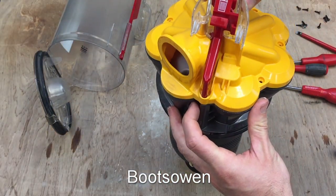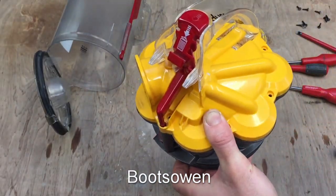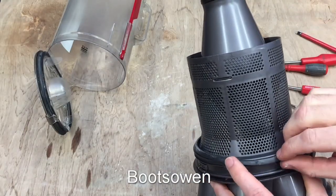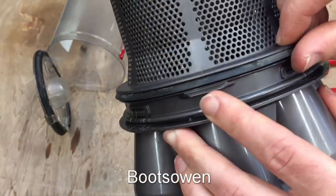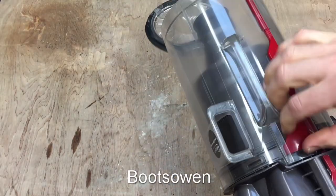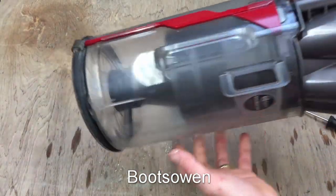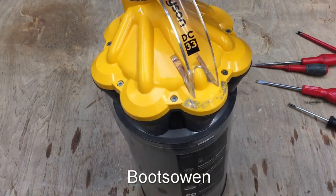I'll put in the remainder of the screws. I'm pretty sure I've put this gasket on the wrong way around, so I'll flip it over — because when you push the plastic thing up from below, the fin would get caught. So the fin is now facing the right way. Let's put this back together: red meets red, put the grey tab in there, clicks in like that, and that's snapped on. Then the bottom clicks on — let's check the operation. That's fine. So that's it — Dyson DC33 canister, good to go again.